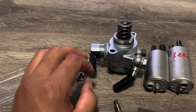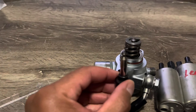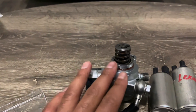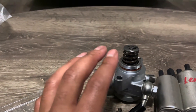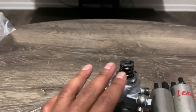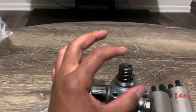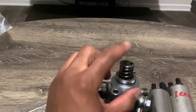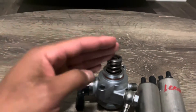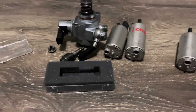We don't have a fuel pump replacement — we tried it and it didn't work. We could keep testing different fuel pumps but the problem is we don't know what the piston size is going to be once we open them up. The Acura piston was not big enough to flow more. Rather than waste money on more pumps, we should measure different cams, because the 2.5 has the biggest cam lobe for this fuel pump. We're going to try to get that exhaust cam lobe bigger so it can push with a longer stroke to get more fuel.